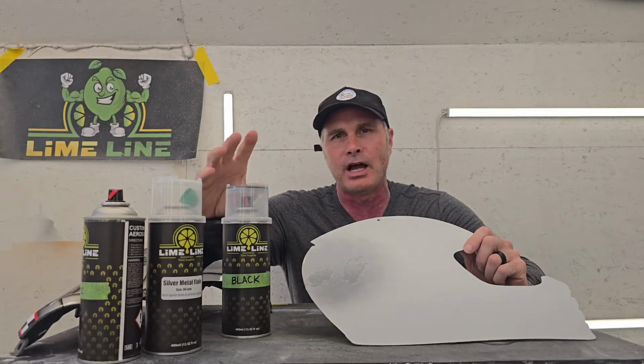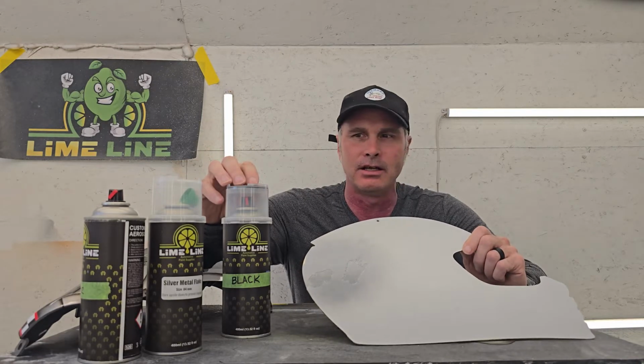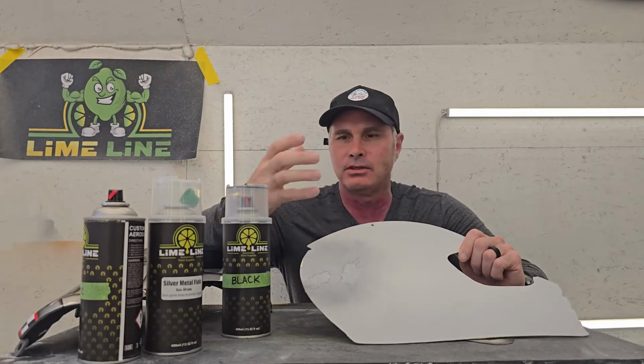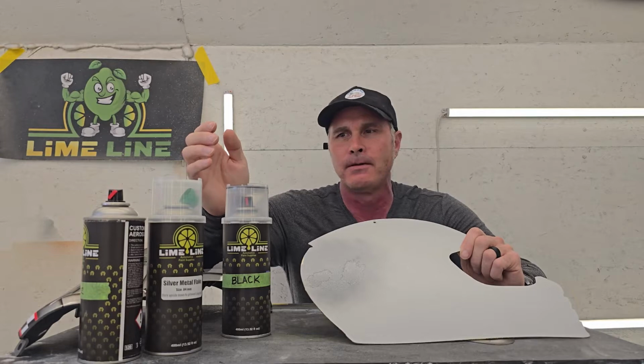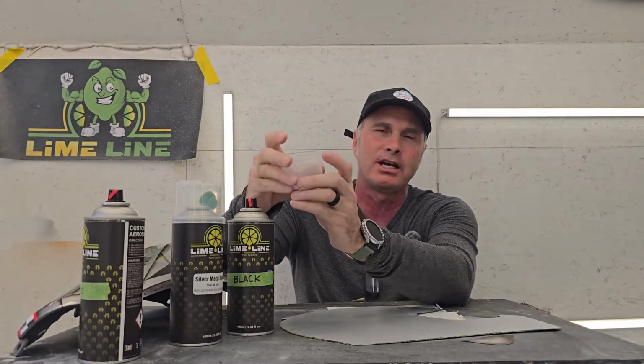I was lucky enough to be able to go to Limeline's packaging facility with Adam Paul, and he showed me exactly how this was packaged. I'm glad I did, because it's pretty cool. Whether you get the black, white, base coat, silver, metal flake even, any of that like you buy in the can, he takes that, and this special cap here, without getting into too much detail, has an adapter that goes in the cap. You fill this up with whatever color paint you're going to put in the can, and it goes in this machine and it puts it right in the can. So you're really getting urethane paint with nothing else in there. The can already comes with the reducer required for the proper mixture, and the air. But the only thing you're adding is that same base coat like you would mix up to spray anything with. And it's urethane, which is pretty awesome.